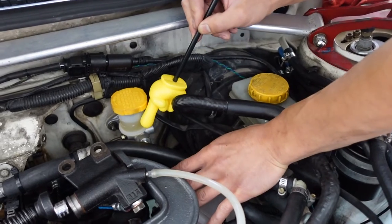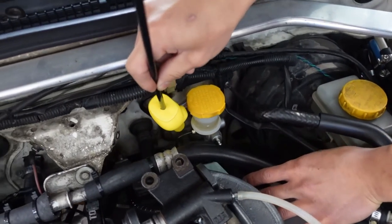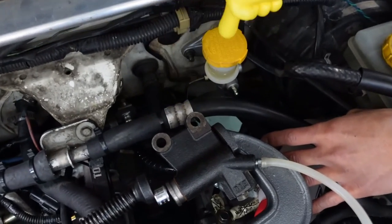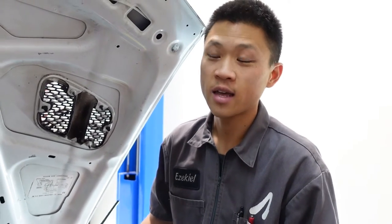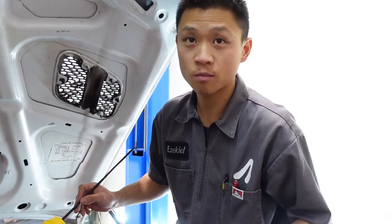Big shout out to my buddies at PM Auto Works, who informed me of a common thing that goes wrong. Another way you can check is to undo the hard line right here off of the clutch master — same thing, if fluid's not coming out of there, something's wrong. After telling my buddies at PM Auto what happened, they told me it's not unusual sometimes on an STI. A car comes in for a clutch fluid service, nothing's wrong with the car, and once they start flushing the fluid, all of a sudden fluid does not want to come out of the master. Every single time, replacing the clutch master cylinder solves this problem.